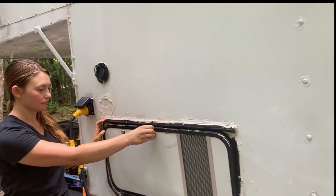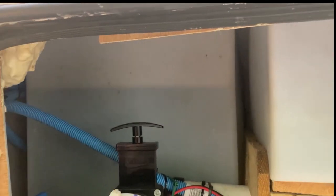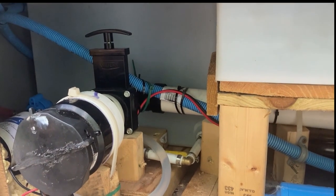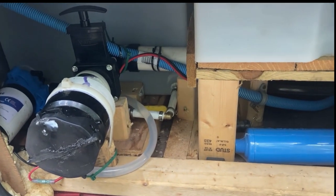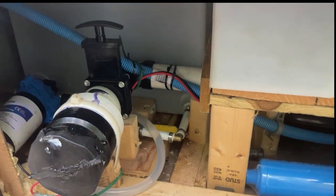Nash is going to open up the side compartment door. So if you take a look here — we've got the fresh water tanks, it's a 75 gallon fresh water tank. And this here is a 40 gallon gray tank — it's kind of wedged up in here — and of course we've got our dump right here, you can see the lever and everything. So everything is indoors. We just really got to watch it whenever we're dumping the gray just to make sure we don't spill any inside. It's all indoors which is nice during the winter since we full time — we don't have to worry about anything freezing. But at the same time if anything spills you're kind of indoors there. Luckily it is just gray.